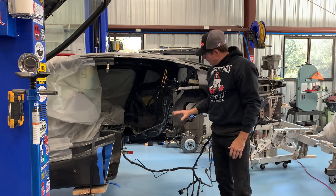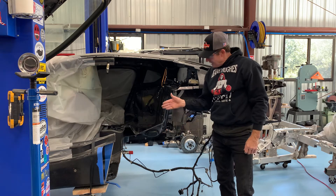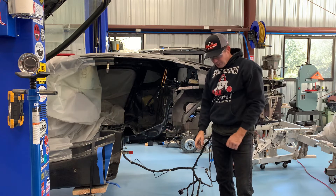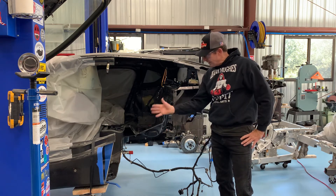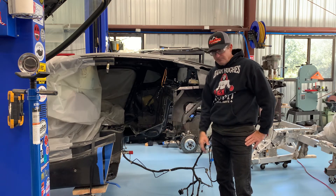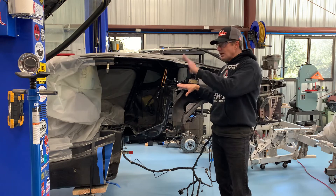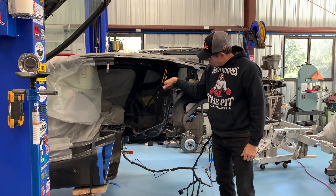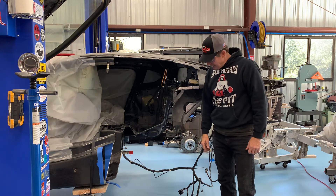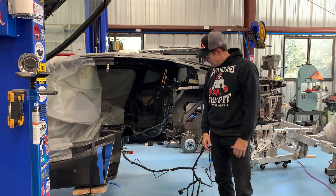And that's the quarter panel opening up into the back seat area. So what I'll do is I'll make some bonding reinforcement plates, get those bonded into place, come up with a strategy for that, and then bonding on the outside where I can add extra strength to the joints. And after I get this outer piece bonded in and check my door gaps, then I'll start working on replacing the inner back seat pan area. But as it stands right now, my joints are looking pretty good — I've got a nice tight fit on everything as you saw.